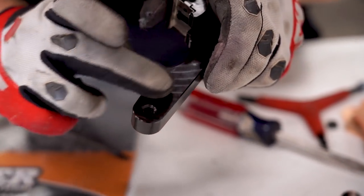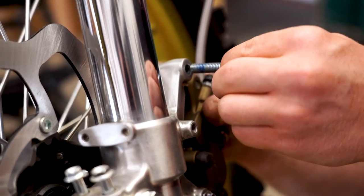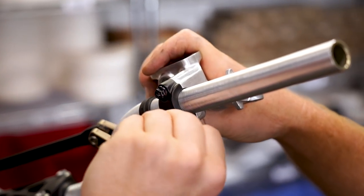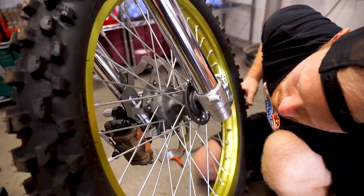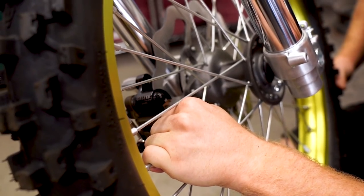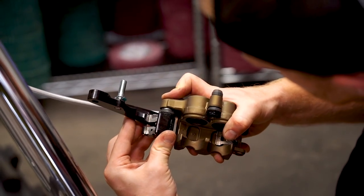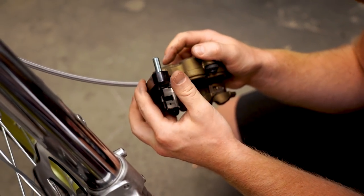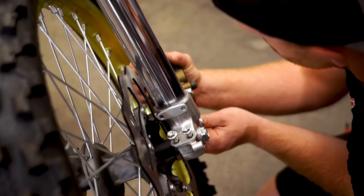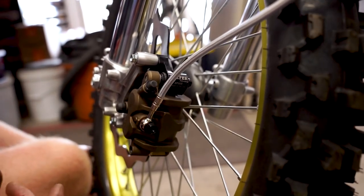See how this thing clears — oh yeah, it's pretty much flush. Looks like we are having a little bit of drag on this rotor. Wonder what that's all about — the pad is a little sucked into the rotor. It's always fun running into little issues like this. It's kind of bulged up right there and it won't go on any further. Looks like we are able to get it in far enough now. I think it was just a case of me getting a little carried away with the lube. It definitely sounds a little crusty but it spins a lot smoother now.